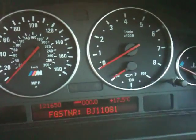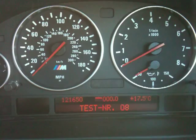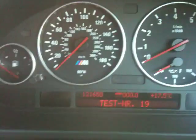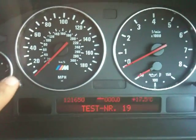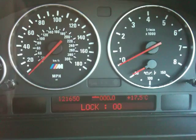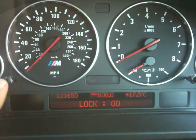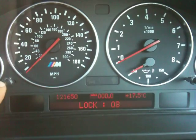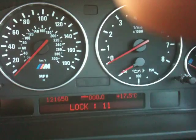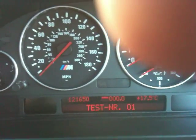Press the right stalk again and keep pressing it until you get to test number 19. When you get to that, press the left one, and that tells you that it locks on. You want to turn the lock off, and to do that it wants you to put in a number. The number you need is 11, because that's the number you calculated from your chassis number. When you manage that, press the right one again — it looks like nothing's changed, but actually it has.